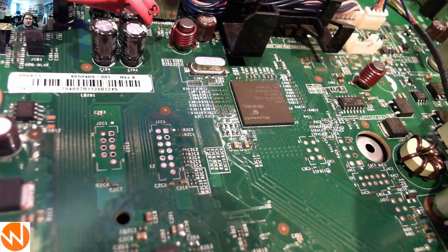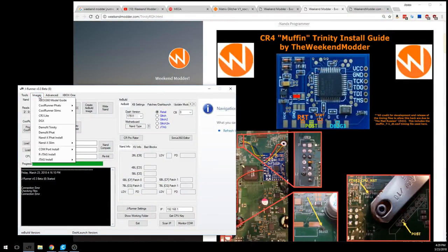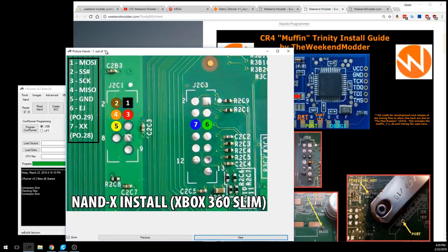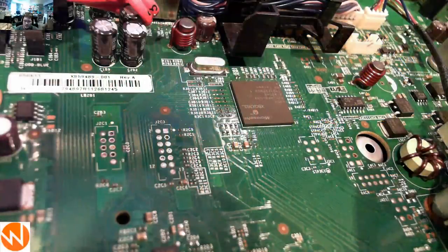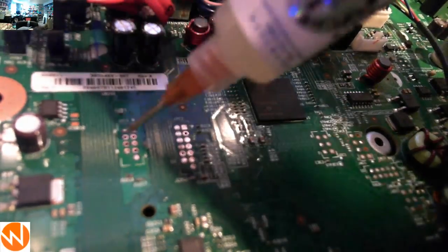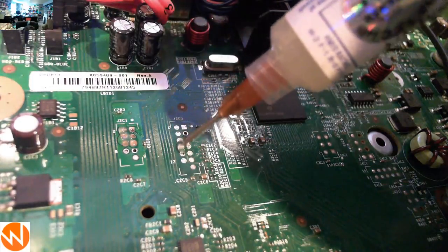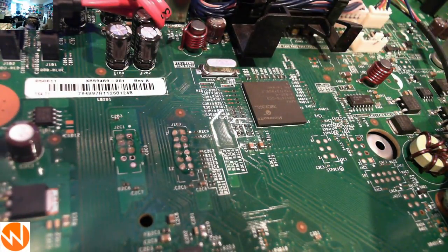To read and write the NAND, pop into JRunner's Images dropdown and go to NANDX Slim, then Trinity Install. This image closely matches the header we were just prepping with the fiberglass pin. We'll do the wire install following that color-coded diagram. I'm hitting the points with some flux paste and then pre-tinning the spots before installing the wires.